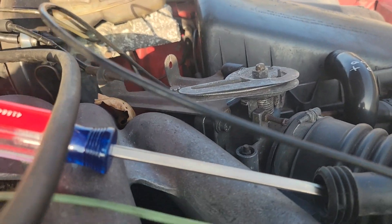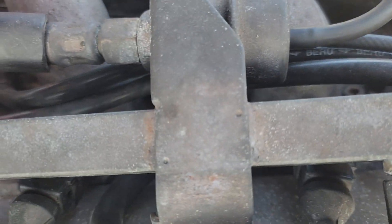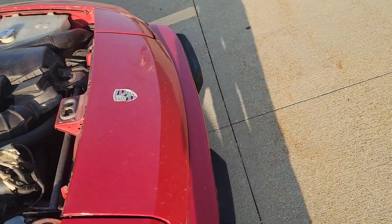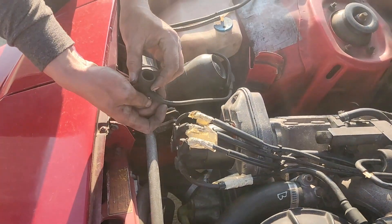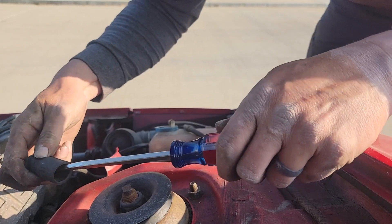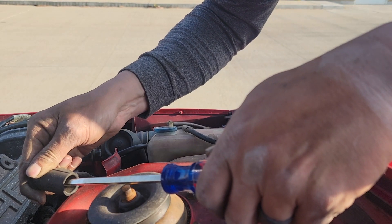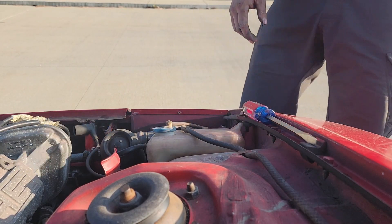We crank it for a second — do it again. We're not getting spark. Not getting spark. So did the coil fail? Let me try that. Try again — still nothing. Let's look at fuses for the coil quickly. Maybe the ignition coil fuse failed. G2 is fuse number 53 right here, and G11 is fog lights. We swap those two fuses.